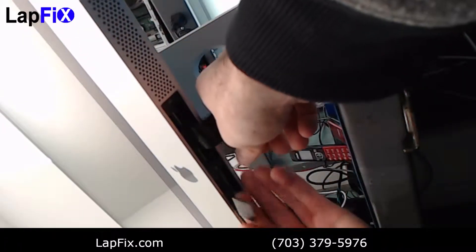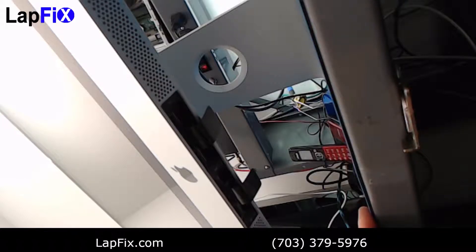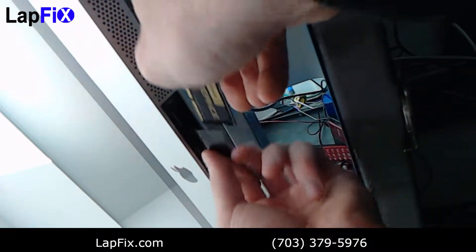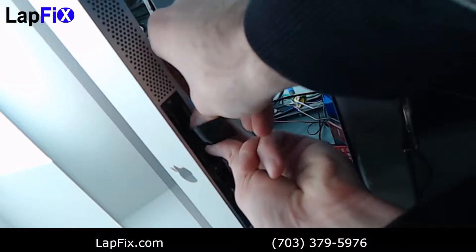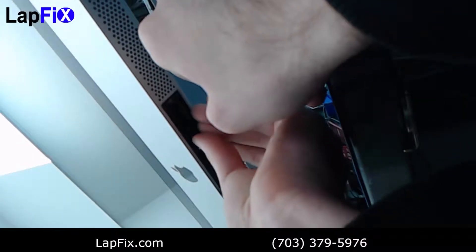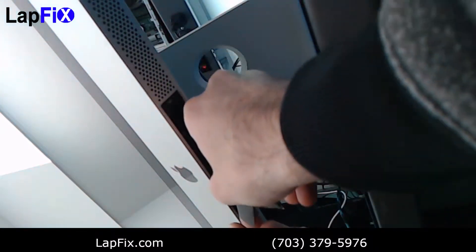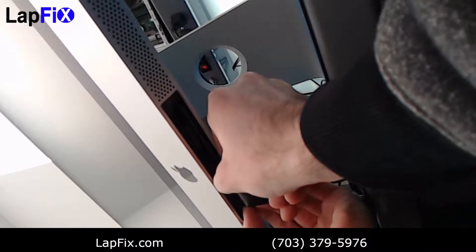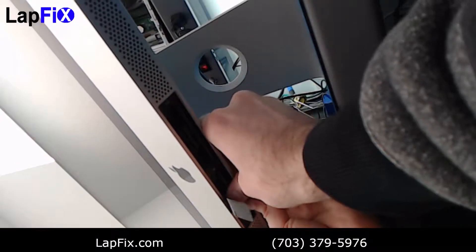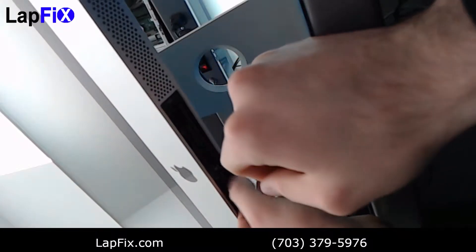But what we're going to do today — you pull this one out and there's the other two gig — we're going to do two sticks, dual channel. You want to make sure they go this way. You can put them in the same slot since there are actually four up there. Once you get it in, just push up — you can feel a little click and it feels very secure. Then put the flap back in just like that. Do the same for the other one, push up, feel the click, and fold the flap back in so it's covered.